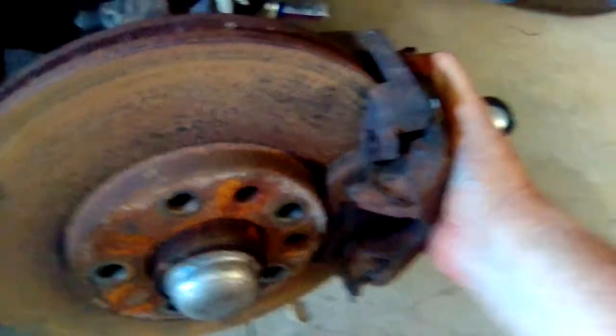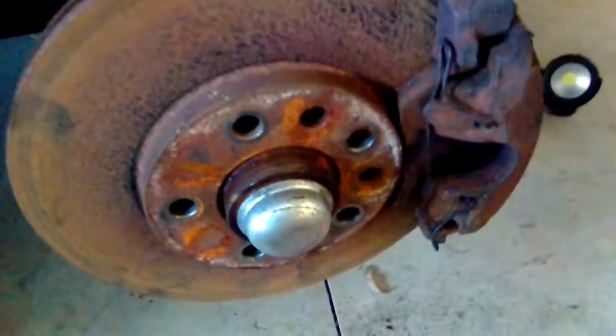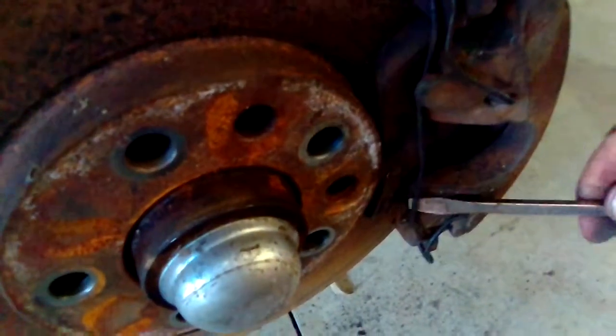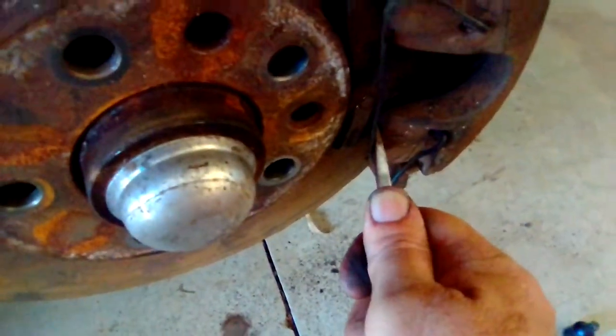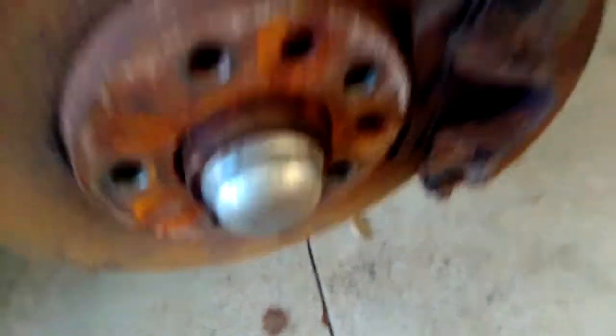A little bit of manoeuvring around like that. I also leave out the pins on the back of the caliper so it's actually pushed in towards the front of the axle. Finally you've got this tab here where the spring's got to go over. On the bottom I just get a screwdriver into it and it should just lever over in place — just like that.